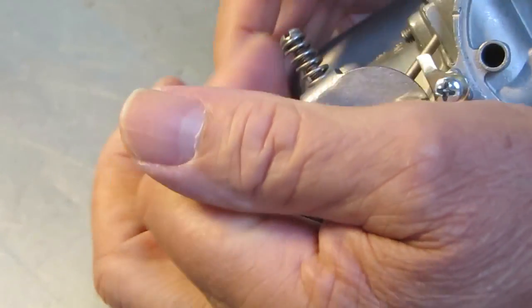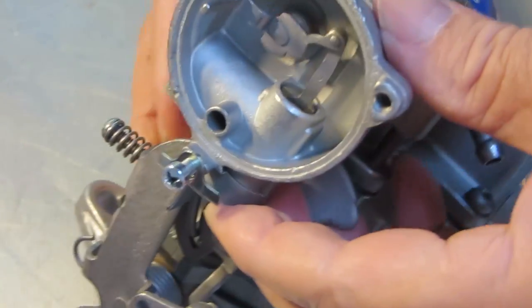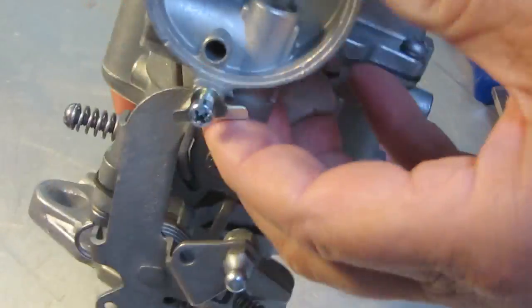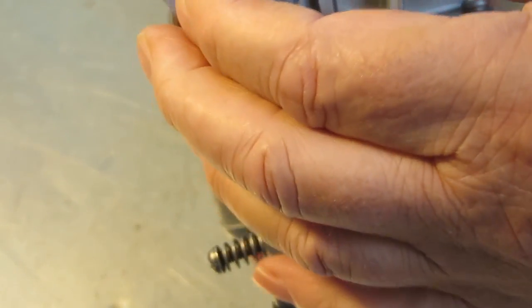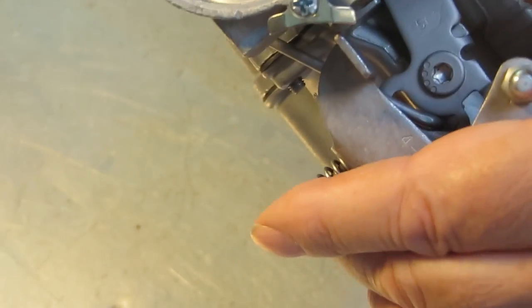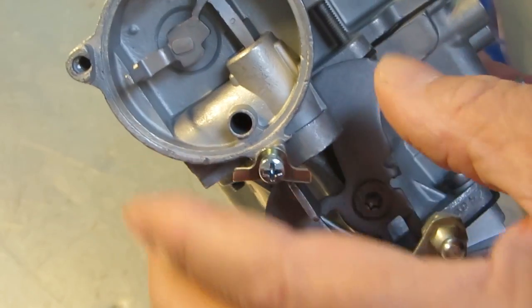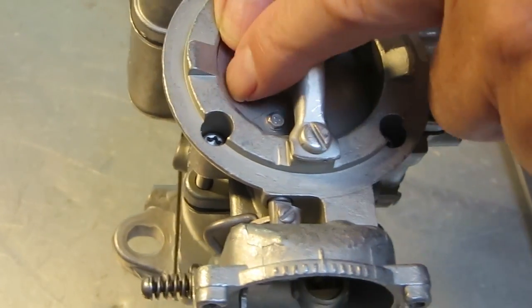If you need to clean it out, there's your plug. Take that plug out, clean it out, and then put a new plug in it. You need to measure the plug and then get on our website — we have them by measurement. When the engine is cold and you stomp on the gas, you need that choke valve to open a little bit, and that's what that piston does. It pulls down and opens up that choke valve just slightly, letting more air into the carburetor — otherwise it'll die out when you stomp on the gas.